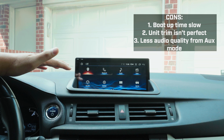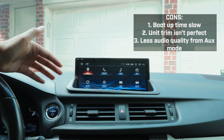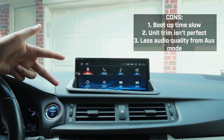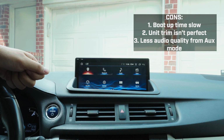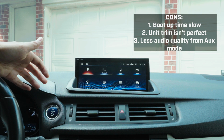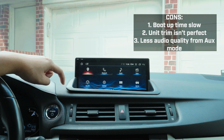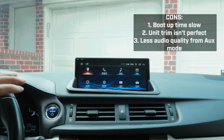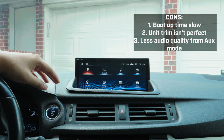I have so many people hit me up when they do the car install, or have somebody else doing the install. They say, hey, I don't have any audio. And the first two things I always say are: is your audio source on aux mode? And two, is your aux plug plugged in? You'll be surprised how many times people go, what aux plug? Or, I'm on Bluetooth. No, keep your OEM source on aux and your plug plugged in. And once everything connects, like CarPlay connects, you will hear sound. Trust me. If not, then it's more towards the wireless or harness problem.